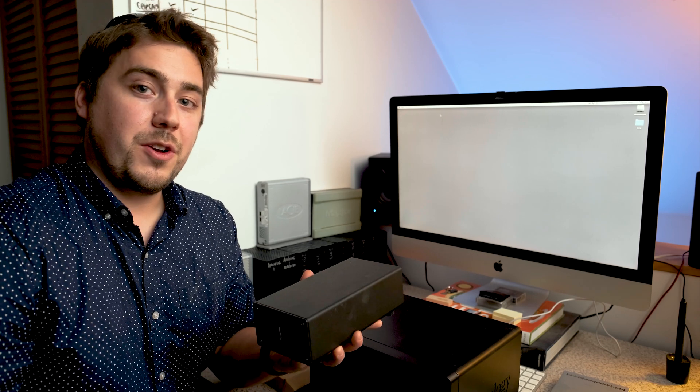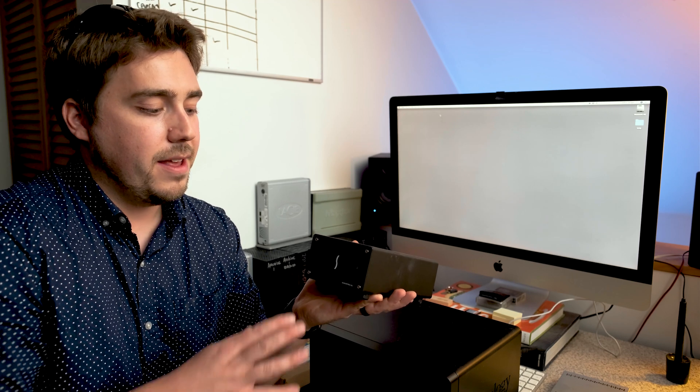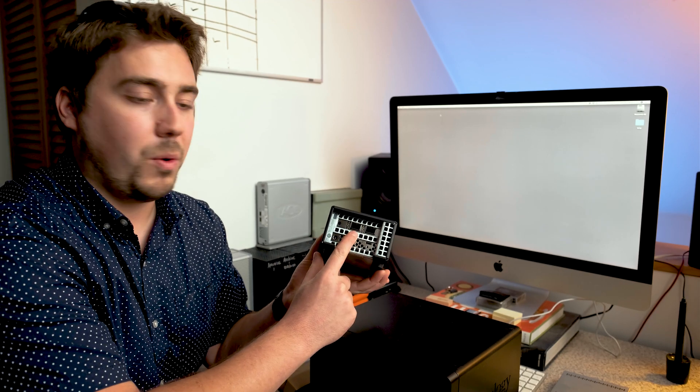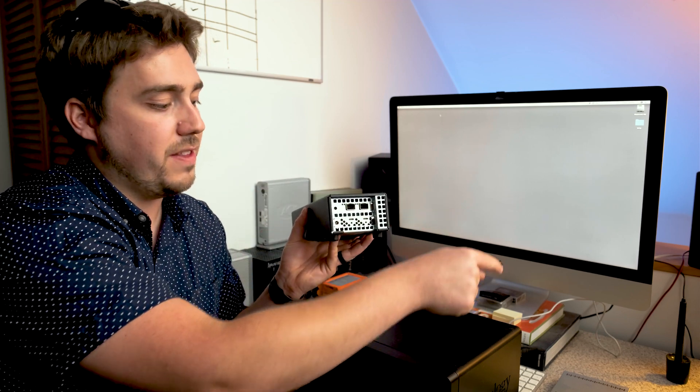The communication between this switch port and the router is not 10 gig, but we don't care because the computer and the NAS are going to 10 gig with one another without any problems. The only other thing you need is a way to connect your computer to the 10 gigabit switch — not a lot of computers have that built in, but it's becoming more common. If you don't have it, assuming you have Thunderbolt 2 or 3, you can get an adapter made by Sonnet Technology. It gives you 10 gigabit ports from a Thunderbolt port, so the computer runs into the adapter, the adapter into the switch, and the switch into the NAS.